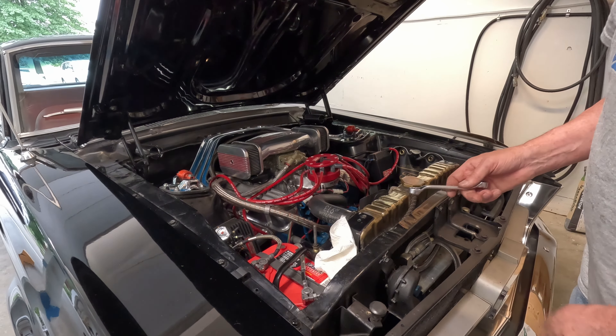Just what I ran into — you might not run into this — but I looked everything up for a 1967 Mustang with a 289 and a four-speed transmission, and it tells me I'm gonna need this one. But what I bought didn't look right. So what happened is they call this the three-eighths model, but what we need is a three-quarter inch model. When we took the old one out, we noticed we had a long nose — a two and three-eighths nose. If you have that two and three-eighths nose, the starter is not the correct one. Will not work.